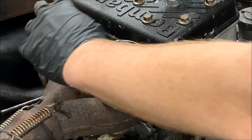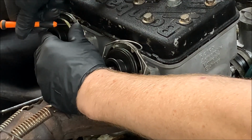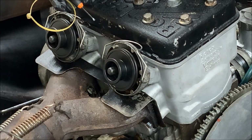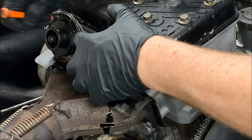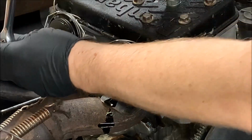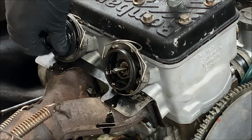And then we're going to go over to the other one. Same thing. We're going to get underneath the zip tie, lift it up, go over, pull it off. And that's how the factory one is. So we're going to put our little micro screwdriver in there and separate the bellows from the front of the valve. Put our screwdriver aside, and then we're going to take our 10 mil, loosen it up, and then we're just going to unscrew the front of the valve